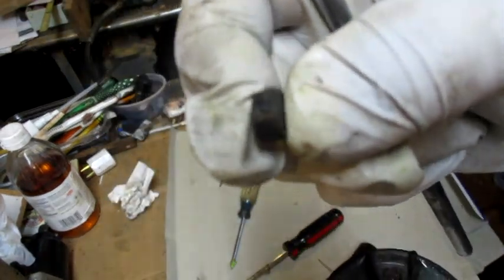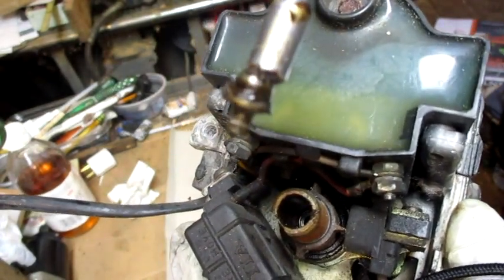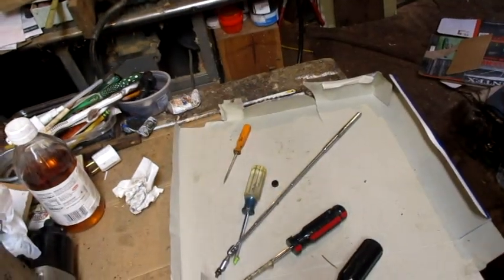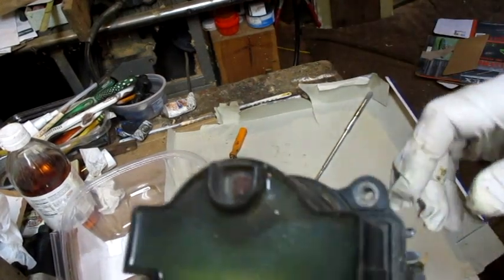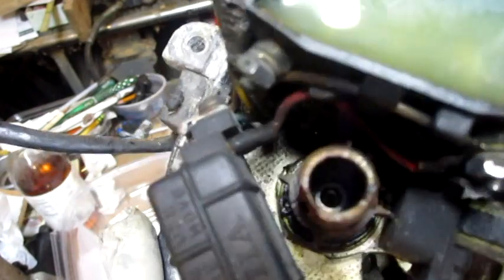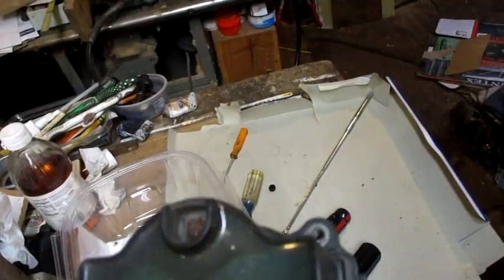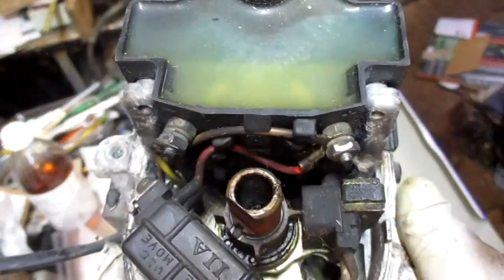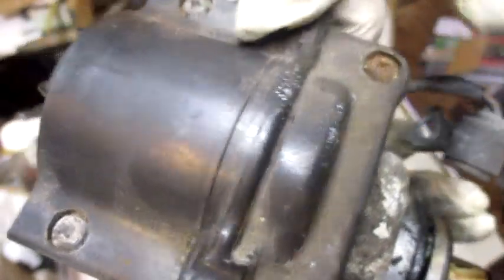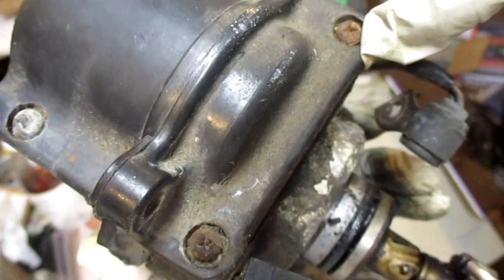First there was the little rubber plug and that screw came out — Phillips head. There was quite a bit of grease packed in there, so I cleaned it out with a small screwdriver before I took the screw out. According to the factory service manual, I'm supposed to remove these two screws, disconnect the wires, and then remove the four screws that hold the coil in place.